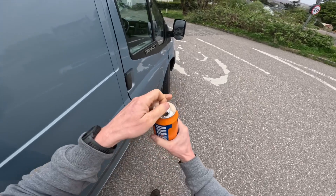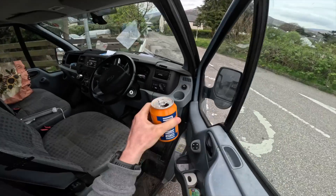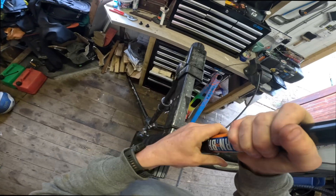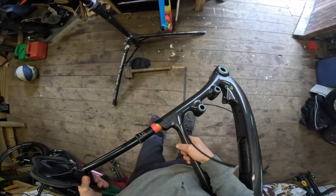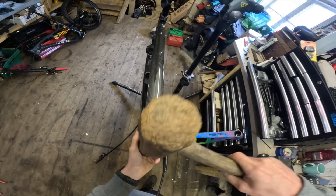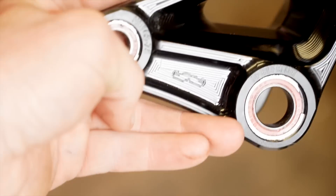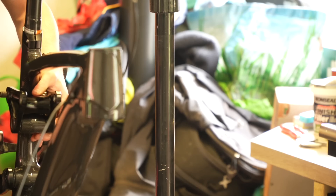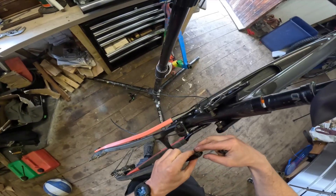The seat post is changed size to a 31.6 from a 30.9 from my original prototype frame. Got a special rocker link, moustache, top chief mullet, secret codes. Let's get it on the bike. High setting on the flip chips for the mullet - the small back wheel.